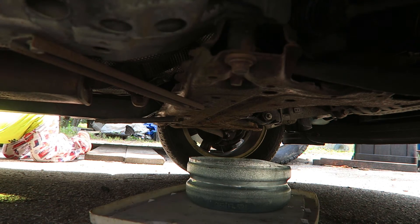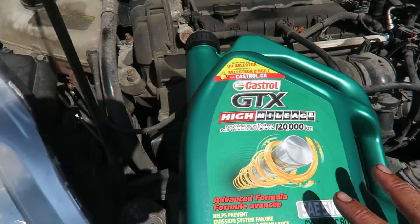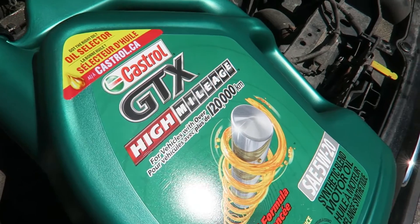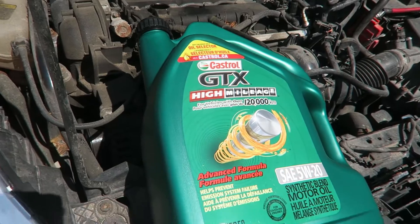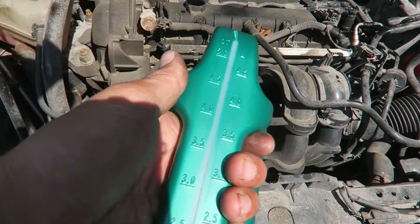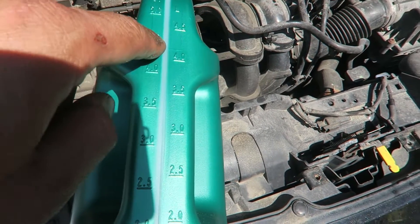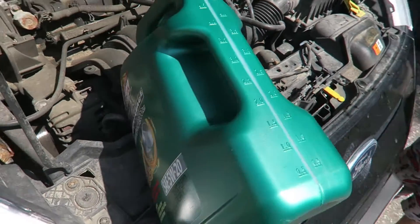It's probably way up there if I remember correctly. One of the tricks I've always done when changing oil — especially now that we're using Sea Foam because it tends to pull out a lot of stuff — is before I change the filter, I'll actually throw some clean oil through the system to try and get any sediment that's settled at the bottom of the oil pan. This engine takes three and a half to four quarts, so I'll take it down to four and a half, leaving half a quart to play with. It makes measuring a little bit easier too.